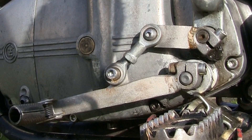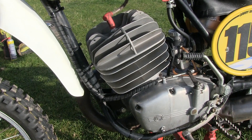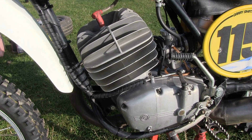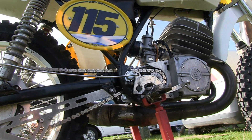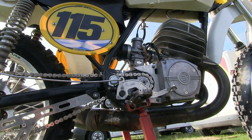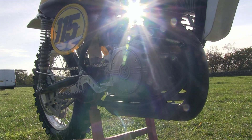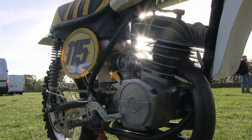The cylinder barrel on Gary's CZ has undergone some engineering work — he's had some of the cooling fins on the barrel removed. Some people say this is to reduce weight and improve cooling, although the other school of thought is that it's done simply to stop mud clogging up between the fins if you were racing at a particularly muddy event. Either way, in terms of ruggedness and reliability, these two-stroke CZ motors could take a lot of punishment and were very powerful for such a compact 1970s motor.